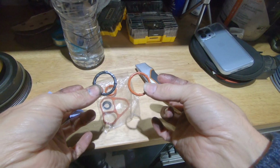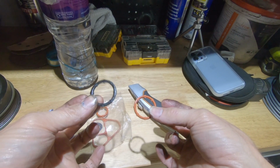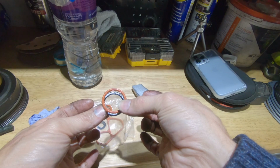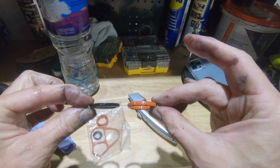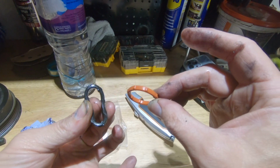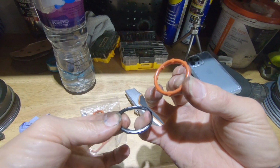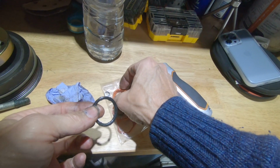Right, so this is the gasket that's just come off the entry point where the oil goes up into the pump. This is a replacement. So the biggest thing you can tell there, you can see that this one's a lot fatter. This one's just completely crushed, and it's very hard. This is, look, nice and pliable. This one is just stiff and it's lost everything. It doesn't help that someone's just siliconed over it. That's just really bad. Please don't do that.